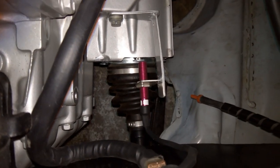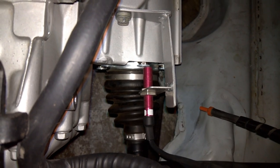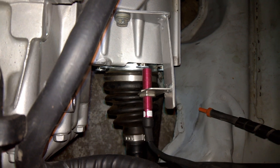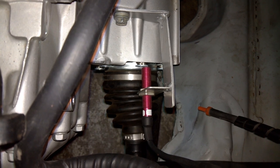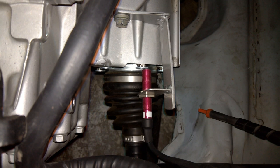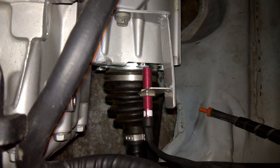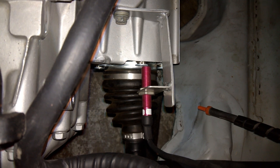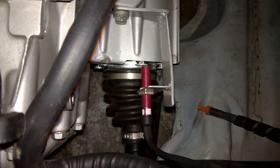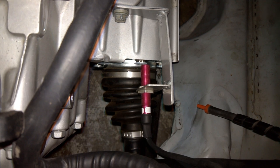So firstly, we got the speed sensor that I'm working on. You can probably tell from here — it's supposed to be that close. According to the Cherry Hall sensor setup, it's got to be between 1 and 1.5 millimeters away from whatever source it's getting the signal from. So I made this bracket and I wired it in, it's all ready to go. The only thing I forgot in my zealous nature is that the bolts I'm using to hold on — to clamp together that axle cage — are Stage 8 locking bolts, and they're stainless steel. Not magnetic. I completely spaced this.